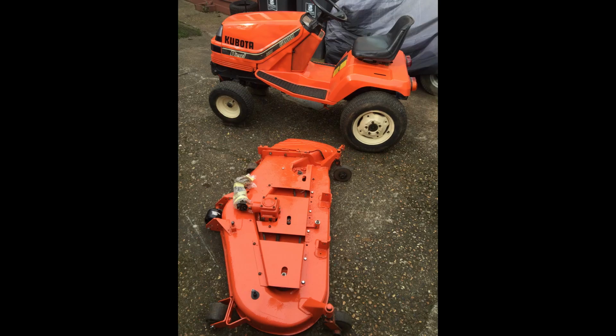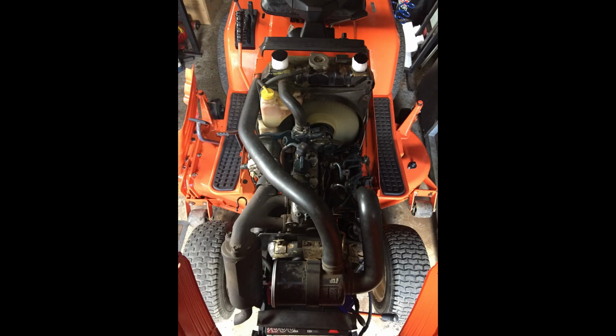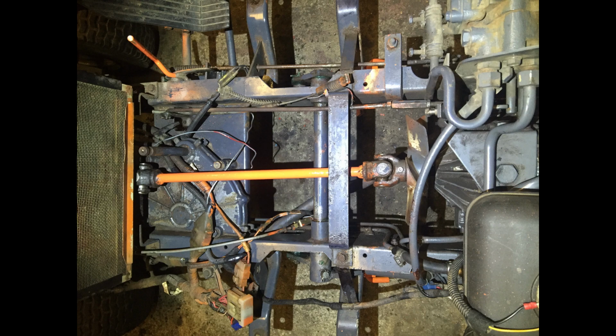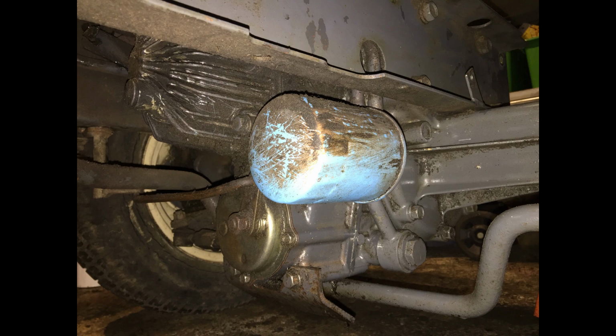The next one from today's list is Kubota G1900S. This tractor was manufactured in Japan between 1989 and 2000 in 2 versions, 2-wheel and 4-wheel steer. It is equipped with an inline 3-cylinder water-cooled diesel engine. The displacement of this engine is 619 cc and the gross power is 18 horsepower sent to the hydrostatic transmission via horizontal shaft. I was able to find some general technical details about the Kubota's transmission, but nothing about the rated torque, hydraulic pressure, maximum static weight on axle or maximum towing capacity.